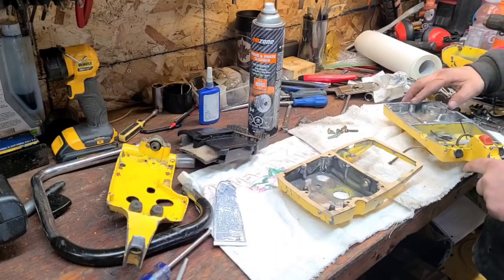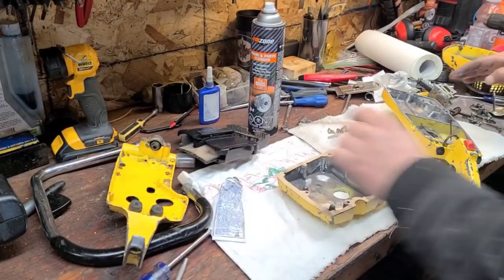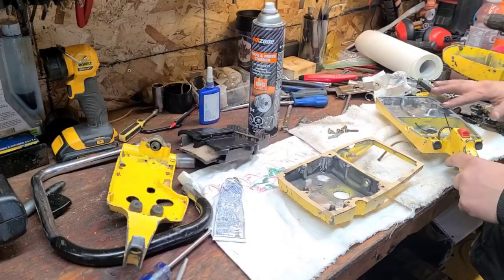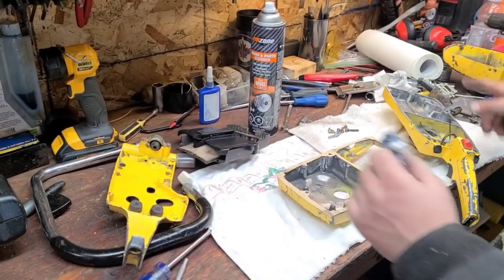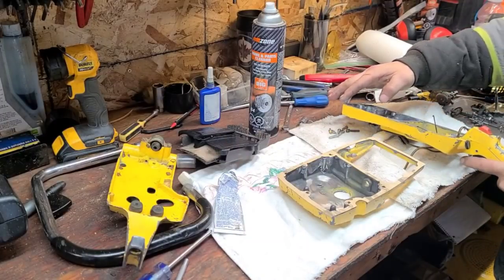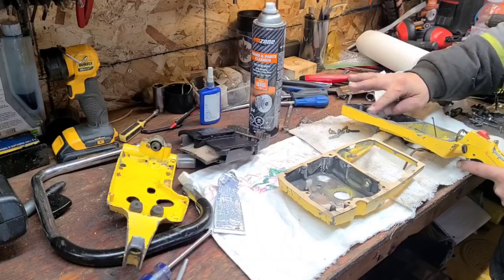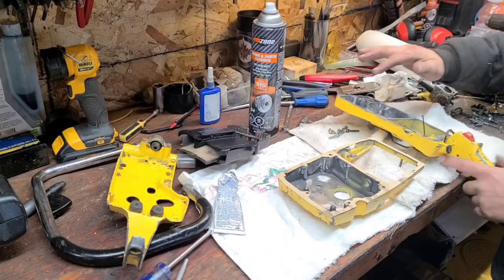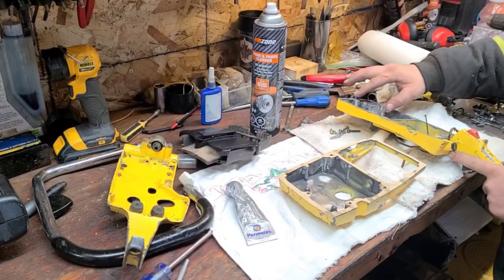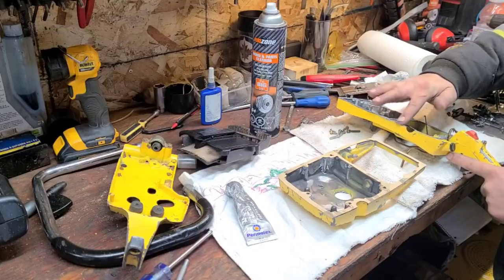Okay, just keep coating this, making sure you get it around where the screws go, because that'll be a source of a leak. Now, we were leaking in this front corner here. It was very corroded in that corner, and the gasket was completely rotten, so this should fix it up. I think it will. We'll be positive. I think I can. Okay.